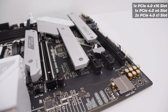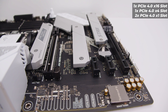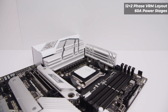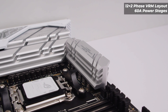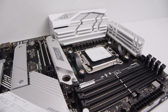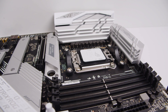In terms of PCIe slots on this board, it's got four in total: a PCIe Gen 4 x16 slot at the top, two x1 Gen 4 slots, and a x4 Gen 4 slot at the bottom. In terms of the VRM layout, this board features a 12+2 phase digital VRM with 60-amp power stages. The cooling solution for the VRM is quite extreme — the entire IO cover is essentially a VRM heatsink. In terms of cooler mounting compatibility, this supports most AM4 coolers; if your cooler doesn't come with a back plate, it will be supported — that's basically the rule of thumb.